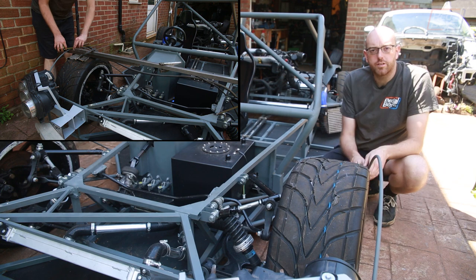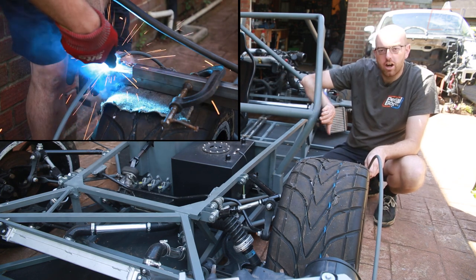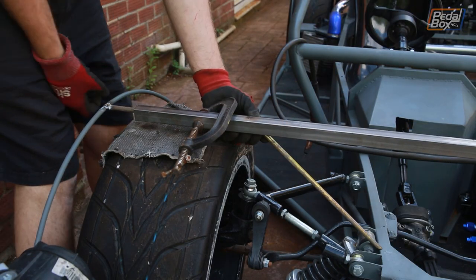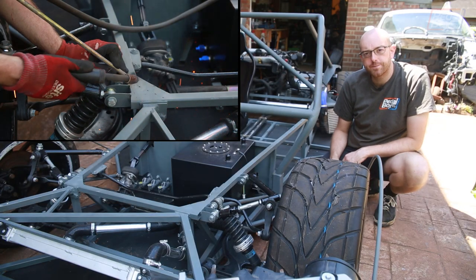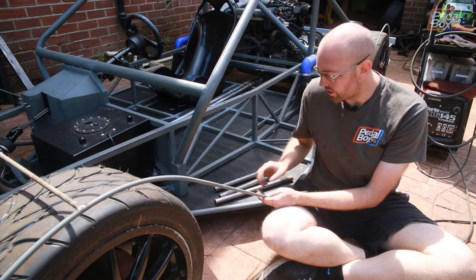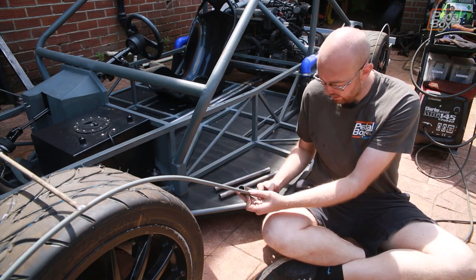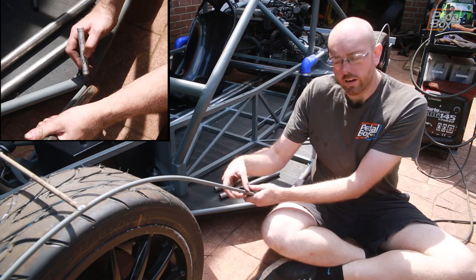After that, I'm going to change part of the back end of this front arch so that we can join it into the chassis off the edge of the roll cage. This is going to come across and be done in one-inch tubes. I'm actually going to remove a piece of the original arch, but we'll build a little bit of structure first. Now we've got the outer edge of the arch laterally stabilised, we can look at what we're going to do to replace it. So I'm going to cut it around about here and fit this piece of one-inch tube, going up from the floor to around here.